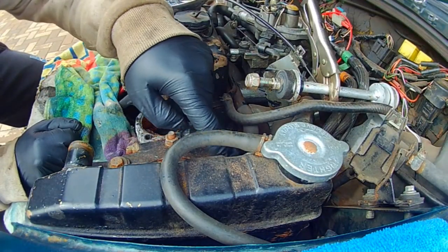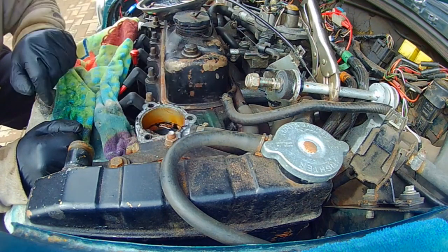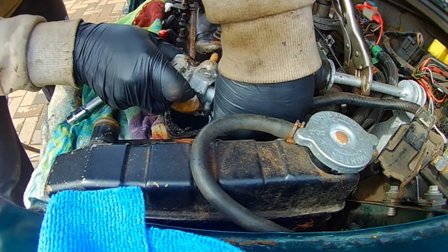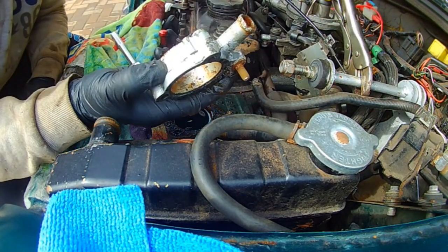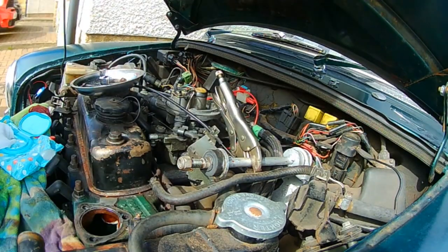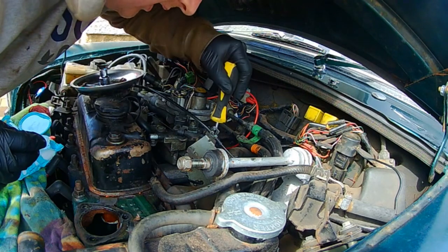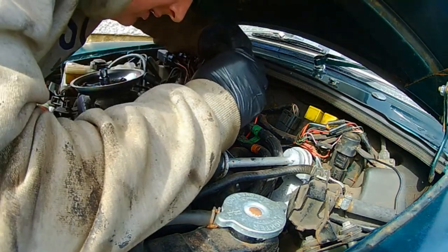The sandwich plate is attached to the bracket on the radiator and needs to come off to make getting to this hose easier. So I'm going to take off these bolts. Looking through it, there are no blockages at all, which is good. Let's get this hose off — I'm going to try the coolant sensor one first, with the theory being that this one will hold it in place better while I work. I'm hoping the screw undoes fairly easily — which it does. Getting it back on, that's the problem.